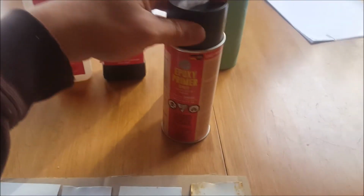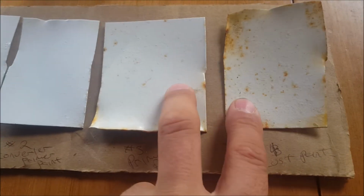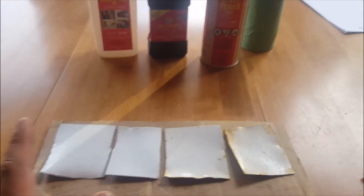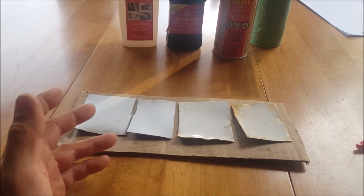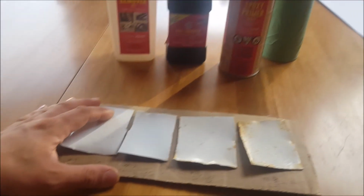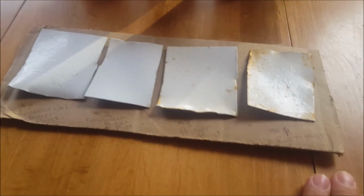So a really good idea for a longer repair would be, when you use either of these two products, don't skip a good primer. Use that good primer, because as you can see between these two, that's the only difference, the primer. And then these ones, the rest was actually treated. So, night and day difference if you've got a trailer, some artwork, a vehicle, some railings or something on your house. Basically anything that has rust on it that you want to protect, this stuff works great. So yeah, part numbers will all be in the description, so check it out, and that is the result.